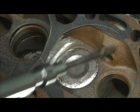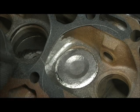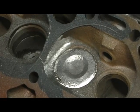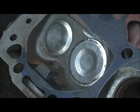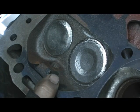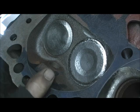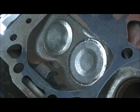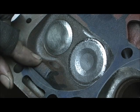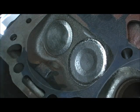I'm going to go ahead and complete that. I'm going to show you how I round-nose this end right here, and then the rest of it is simply prepped for polish work. Then the chambers will be laid, and we'll get on to some more serious modifications. Now, to the next part of the chamber — we're not doing a great deal. I'm trying to watch the CC volume, but I'm going to alleviate this square and round it. I don't believe detonation could occur except maybe on these sharp points, so I'm just going to bring this down and round it, and then the raw material removal is done and I'll begin the polish.